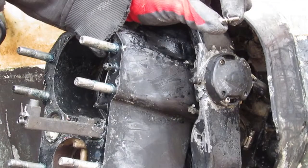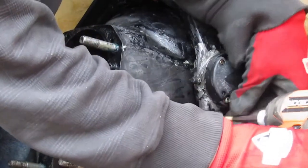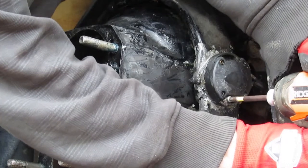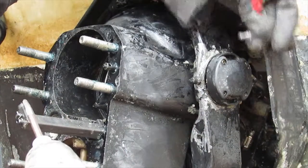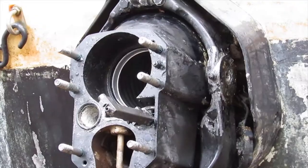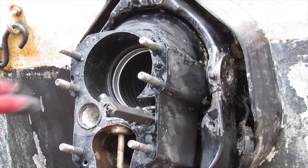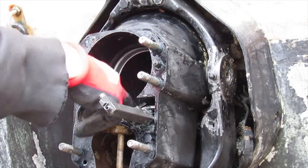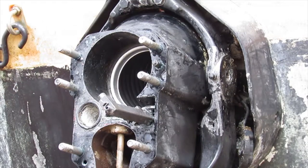And here's our first screw. And our second screw. And the trim center should just pop out like this. Alright, so now that we have the trim centers out, next there's a shiny metal ring inside here in the bellows. So I'm going to go ahead and pull that out, along with your outdrive gasket. It should come out like that if it hasn't come out with the outdrive.